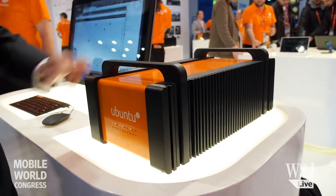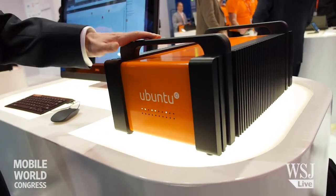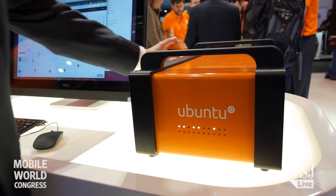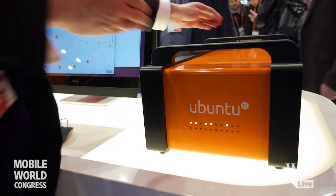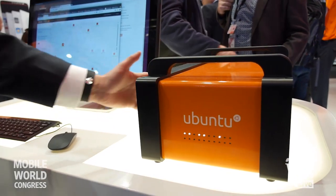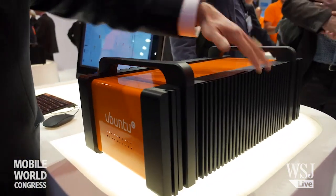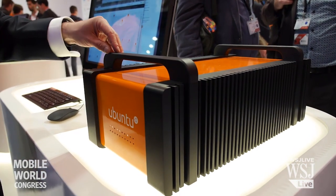This is the orange box. It's got a number of LEDs along the front — each one of these LEDs represents one of the nodes, the servers inside this. Along the side you'll see these big dark areas. These act as the handles so we can lift it up, but these are also heat sinks, so the servers themselves are attached to the side of the box. This means that we only need one fan to maintain cooling for the entire box.